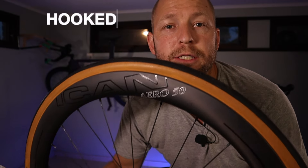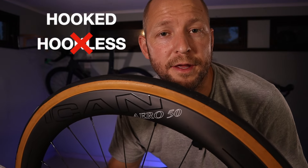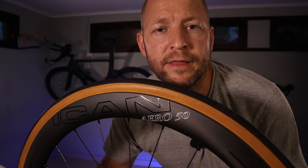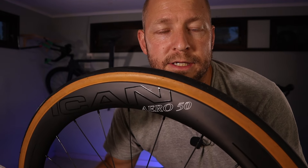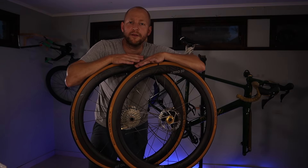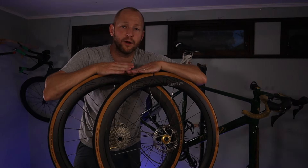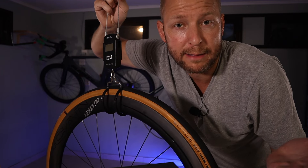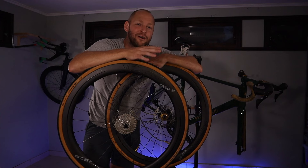As I mentioned, these rims are tubeless hooked — not hookless — which is a good thing. Hookless wheels are starting to appear on some pricier road bike wheels, marketed with the vague argument that it's new technology offering better impact resistance, but it's actually a cheaper manufacturing process. With a high-pressure road tire, the risk of blowing the tire off the rim is tangible. Hookless wheels have a significantly lower maximum tire pressure and limit your tire selection, as only a few tires are approved for hookless rims. Impact resistance makes a big difference on a mountain bike, some difference on a gravel bike, but not much on a road bike. You can save a few grams building a hookless rim, but the saving is marginal — hooked rims are a good thing.